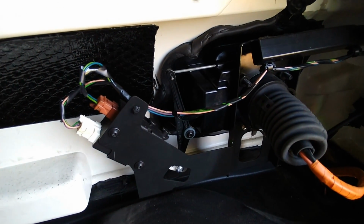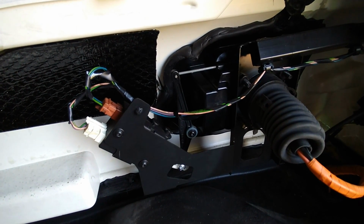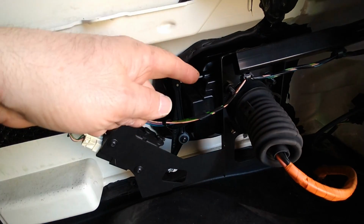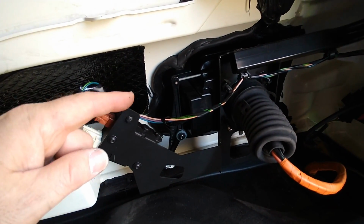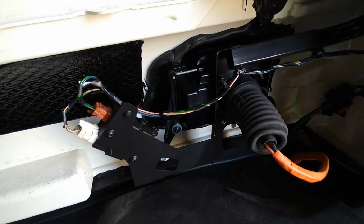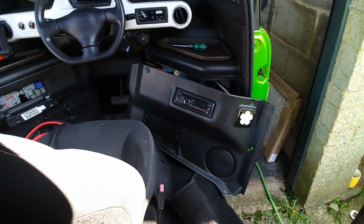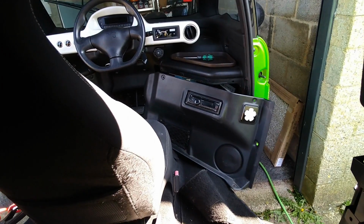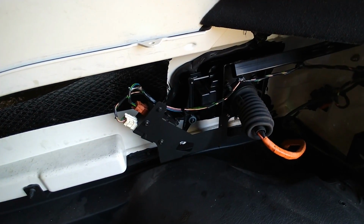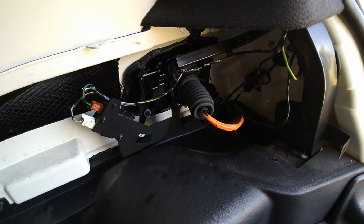The charging sequence should be starting there, and now that lock, the locking pin locking the charge cable in, only works once now, which is correct. So we thought, great, that's fixed that, maybe it's going to start charging, but it hasn't. It does the same, the fan comes on and now charging hasn't enabled. So one step forward, but not enough. There's something else stopping the charging on this vehicle.